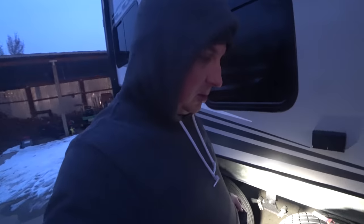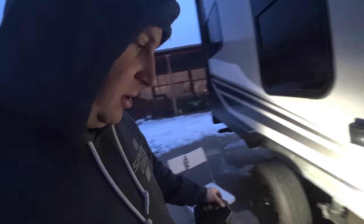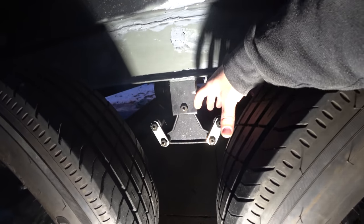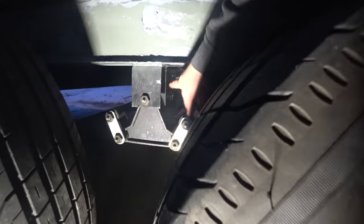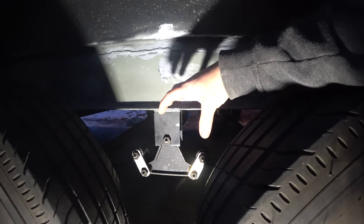A big snowstorm's coming tomorrow so I'm going to be working all night tonight to get part two done. Part two: this is really just 1/8 inch C channel hanging down from the frame. Every time you turn, it puts tremendous stress on these and they want to buckle underneath. Lippert has a repair document for how to fix these when they get twisted — they run a big bar from one side all the way to the other and weld them together so they don't move, then gusset it all in. That's what I'll be doing tonight.